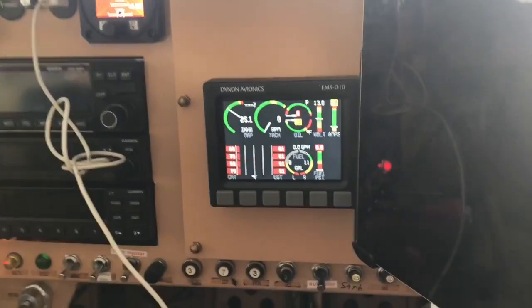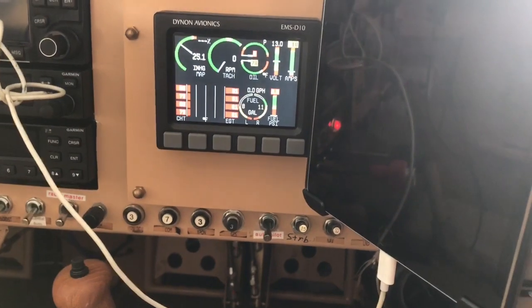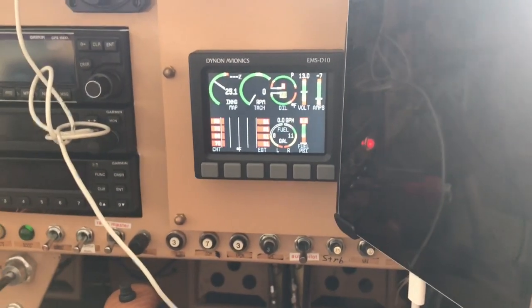I've been wanting to do that for a long time, glad it's done. The amp draw went from about 29 amps down to about 7 amps with all the lights on — it peaks around 10 amps when the strobe fires. That's pretty cool. That's a wrap on that project — if you like this sort of thing, like, subscribe, and comment. Till next time.